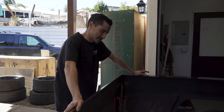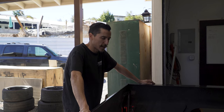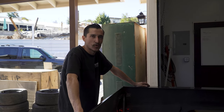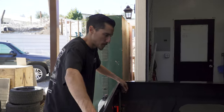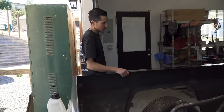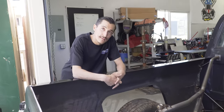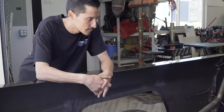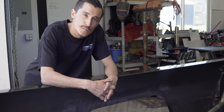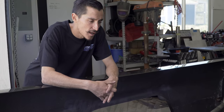Running 91 pump gas. If ever going to an LS maybe E85 would make sense, but 91 is accessible - you don't have to worry about finding an E85 station or race gas. The engine is a 350 small block and just keeps on going. A lot of people dog them but they're reliable if you build them right and take care of them. People still run them in drag racing. The small block 350 is full iron - heads, block, everything except the intake.